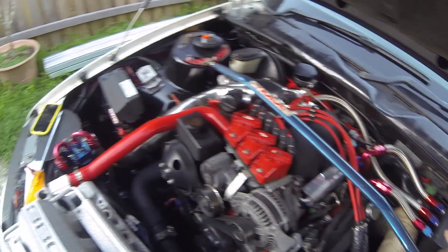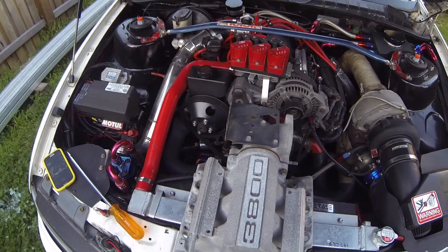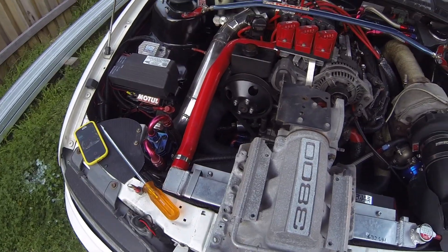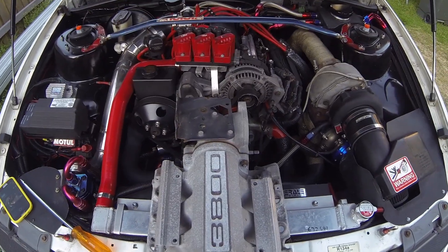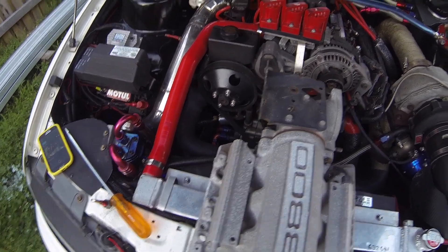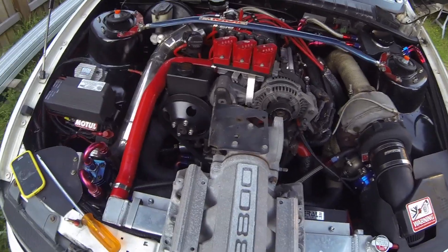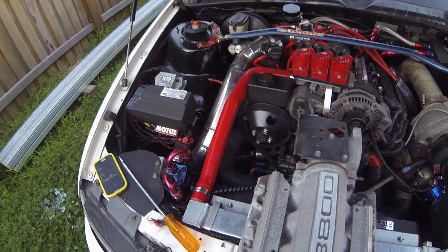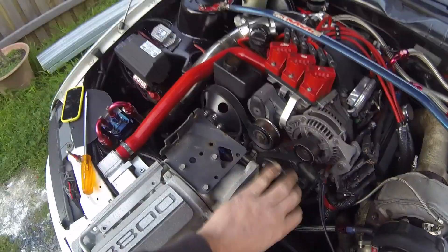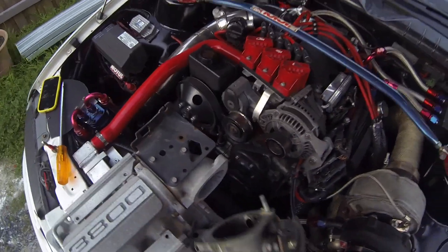But this is how I've chosen to run it — it's a lot cleaner and because this car is engineered it obviously has to comply. So in summary, especially for those of you who still have the stock intake manifold: first step, the PCV valve that's in here under the nut — you have to take that out and either crimp it over and put it back in making sure the O-ring seats down against the little boss in here, or what I actually did, I welded it shut from both sides just to be 100% sure it's not going to leak. That's the first step and that is a must. Now if your throttle is still in the stock position, I've got a spare throttle body here to do a complete mock-up of how it would be stock.